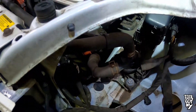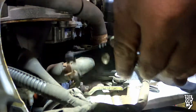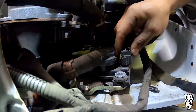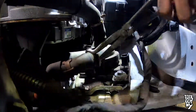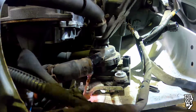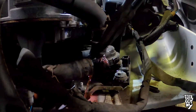With the headlight assembly removed, you guys can now see the inverter pump located right behind it. Slide a catch can under the car to catch the coolant. Next, remove two hose clamps on the two hoses going to the inverter pump. Because those hose clamps were at a weird angle, I used a hose clamp plier and a long needle nose plier to remove them. Remove and disconnect the inverter pump connector and put it to the side so we don't get any coolant on or in it. Using a hose plier, release the hose off the inverter pump. Hose pliers are great for this because they're circular shaped and allow you to grab the hose evenly and grip it so you can pull it out at one time without breaking or ripping the hose.